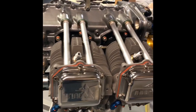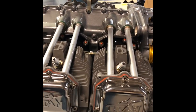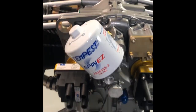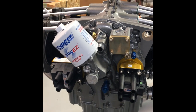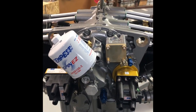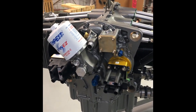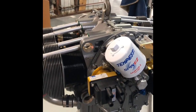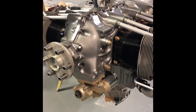What I've chosen is the Titan version, the O-370, which is basically an O-360 with a stroked crankshaft. We have several engine builders we use — Barrett Performance out in Tulsa, Oklahoma, 92nd West Aviation in our hometown, and others. Jay at Jabron actually has a part of his company that builds these engines, and he answered my nitpick questions the way I like to hear them, so I went ahead and let Jay build this engine.